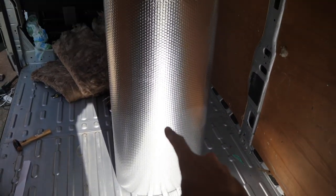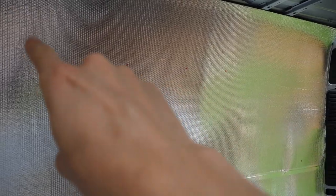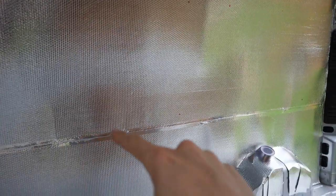Next up is my roll of double bubble aluminium foil. Part of the way through the installation phase it's really satisfying being able to just cover a wall like that. These little red marks are the screws that are screwing the wooden 5mm panels to the walls - I'm using them as a line so I know where the metal ribs are, and that's where I can screw in along those lines when I do my horizontal panel to attach the cladding.